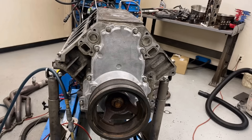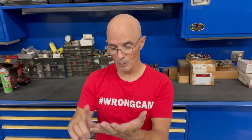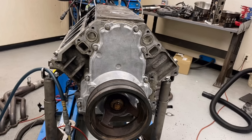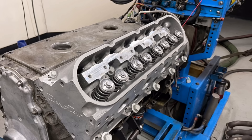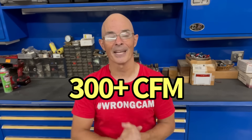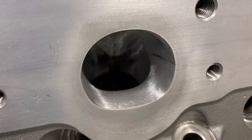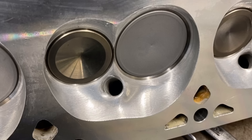I need to make 500 horsepower with this stock bottom end L33, and here's how I'm going to do it. We've got a good intake, we've got a good camshaft, we have the stock bottom end. The only thing we're missing is good head flow. I know the 799s have good flow, but I'm talking about good head flow like an aftermarket head. In this case I decided I'm going to run a set of Trick Flow 220 as-cast heads - specifically modified, super-modified as-cast 220 Trick Flow heads.